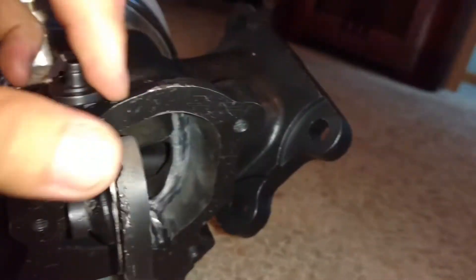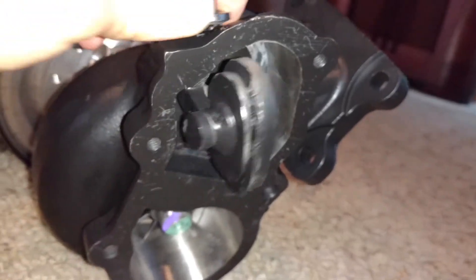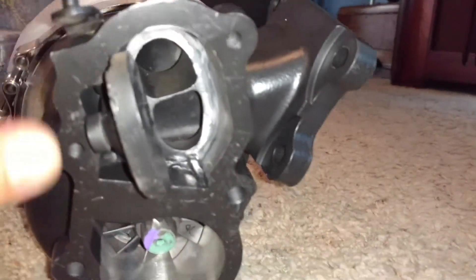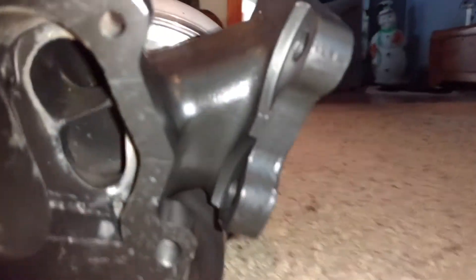Nice and tight. So these are the new BMW bushings on the wastegate flapper. So it's an internally wastegated, fully divorced system, in which I have 74 millimeter here. It's too huge — I'm gonna have to measure these and figure out how big — huge fucking internal wastegate exits.